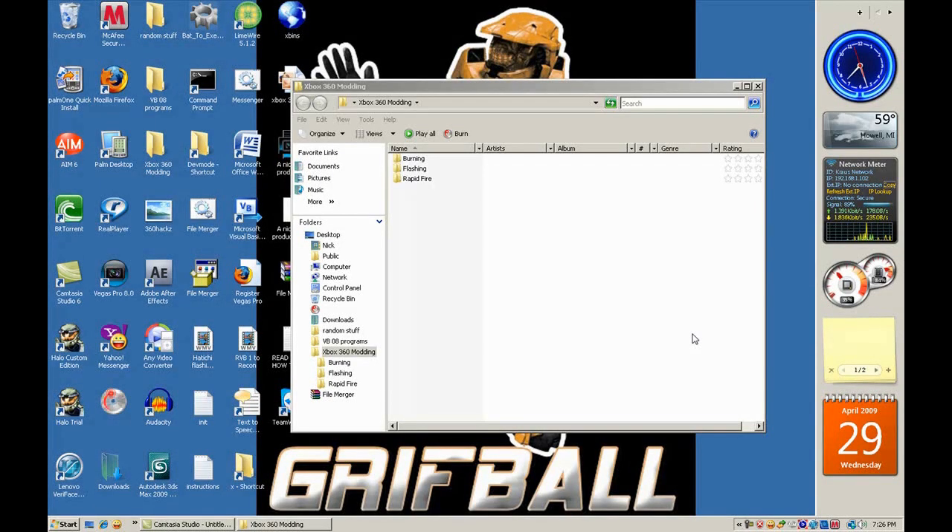We are booted into Windows. We have our drive open and our Xbox 360 on. What you're going to have to do before you open 360 Firmware Toolbox is put a retail DVD into the Xbox 360 drive — it has to be retail. I'm using Hitch. To close the drive correctly, you press the eject button once and then manually close it, or press the eject button twice and a third time before it closes. It will stay in there, then Windows Media Player will open — close out of that.